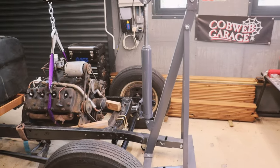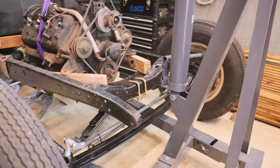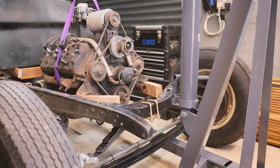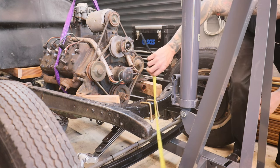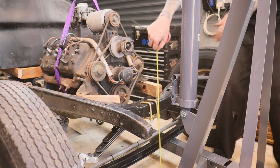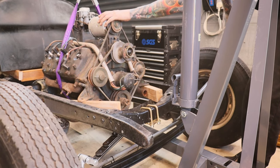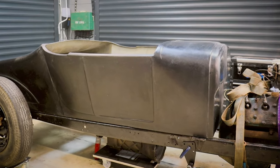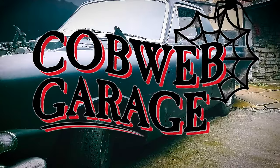There's a bit of weight on the frame now - just the strap on the back of the engine, with the rest supported off the engine crane. I've put some blocks of wood in and I'm going to let it down and let the frame take the weight. That frame gap was about 500mm - 20 inches. And now it's completely supported on the frame - it's come down about 40mm, just under two inches.